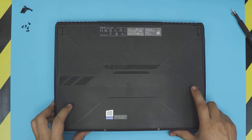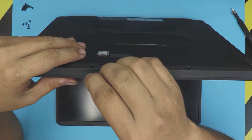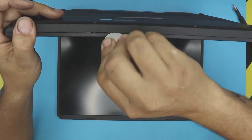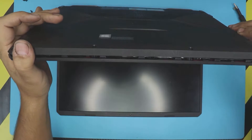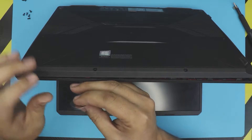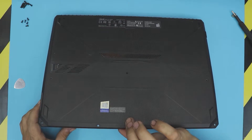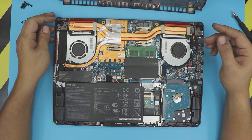Once we remove all the screws, we're going to open up the laptop at a 45-degree angle. We're going to grab an opening tool — in my case a guitar pick — and shove it between the bottom and the top cover, just like that, and wiggle it around in the front. Do the sides a little bit to pop those clips open on the left and right side. Once those are popped open, close the lid, then open it up and just pull up the cover — everything else will just come up.